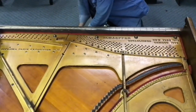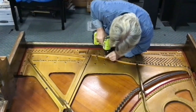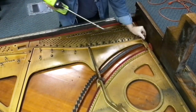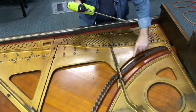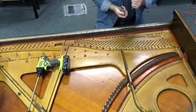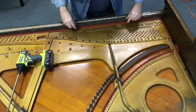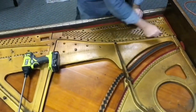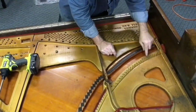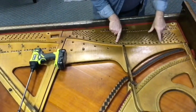Let's get some of these big bolts out now and then work on all the small ones. Now folks, sometimes there will be a strip of felt right here or a strip at the top that's wide. Especially in that stringing area, if there is any felt, you're going to want to peel it out of the way and make sure there are not screws hidden underneath — that happens a lot. It's very common to find screws recessed underneath the felt.